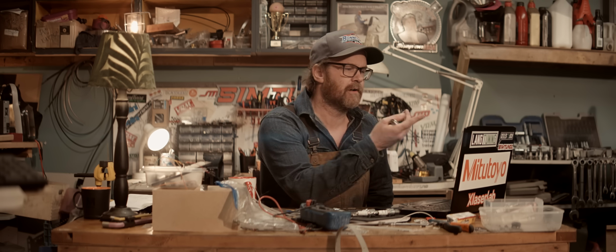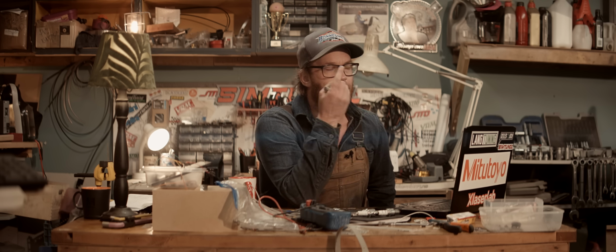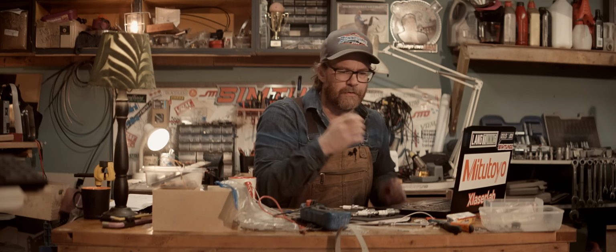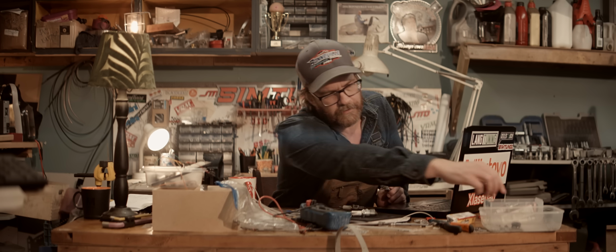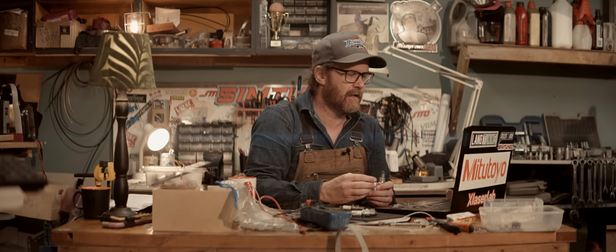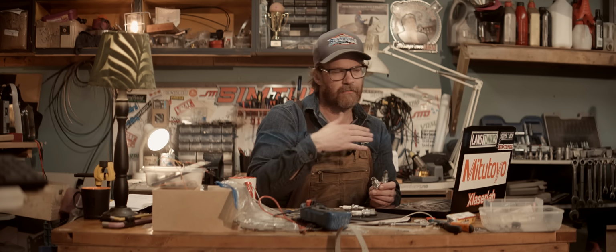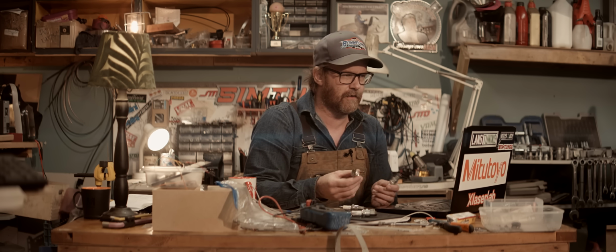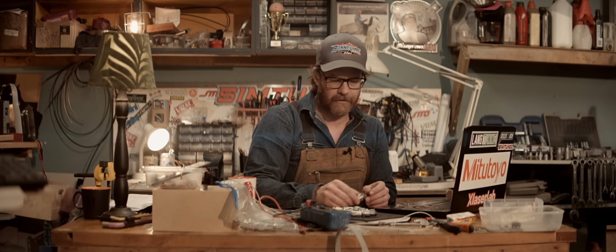I'm gonna bring it in closer, but what I think happened here was, because it was acting just as when the plug starts melting and we're losing ignition, so it's breaking up. That's happened to this plug, and well, this plug. Doesn't matter. Every time when the plug has started melting, we've had the behavior we had here. So I think what happened was we started gaining some heat in the engine and we started gaining more power, and then the combustion pressure blew out our spark because we didn't gap the plug.